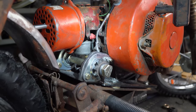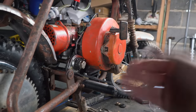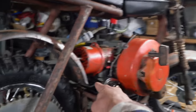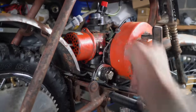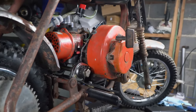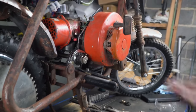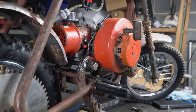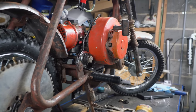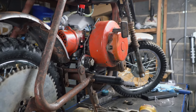spacing. So what we are going to have to do is notch the top engine plate, move the engine to the left side of the bike, put the left side bearing of the jack shaft on the outside of the bracket so the carburetor and linkage have room to move over. And also the whole engine, of course. But that's my project today. I have to remove said engine again, but no big deal. And then we will notch it and get it moved over. So, oops. But we can fix it. We have the technology.